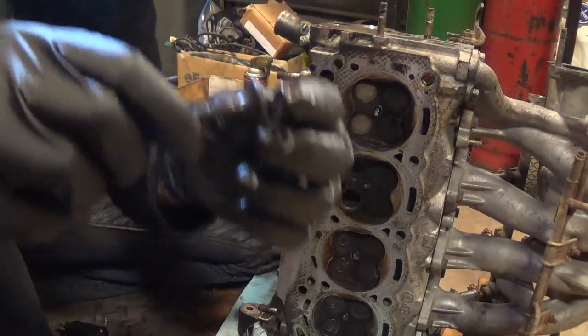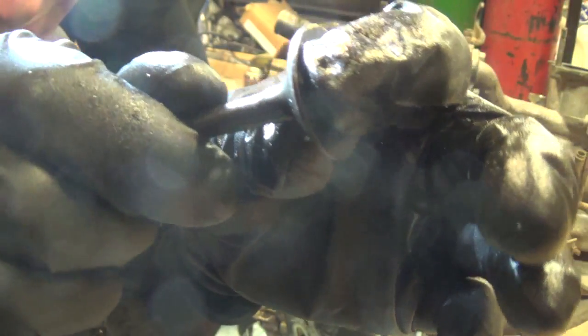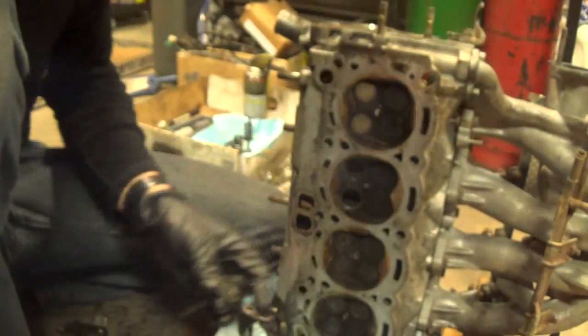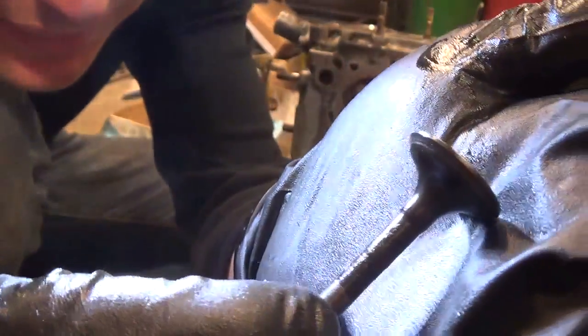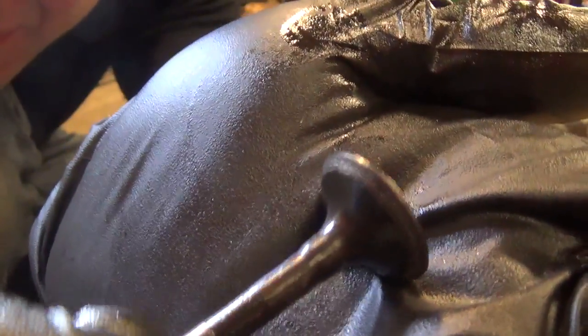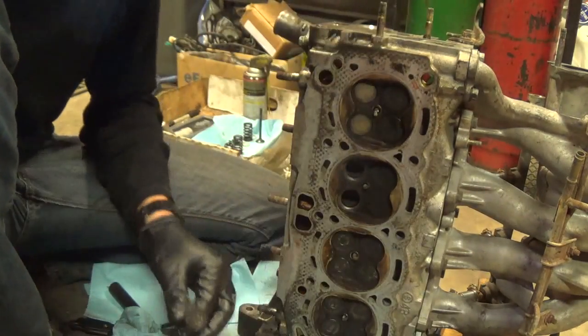I'm lapping the number three valves here. See a slight issue - see that big pit right there? If you look at the edge of the valve real close, it's almost like it's deformed because of that pit. That kind of sucks. I don't have any spare valves on hand, so I'm going to lap this one a little more and it'll just have to seal. I'll be damned - the other valve on number three also has that little defect in it. See right there, there's a pit and it almost looks like it's bent right there at the pit. Hopefully the lapping will make it seal good enough to last.